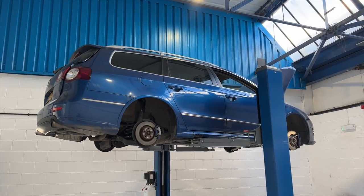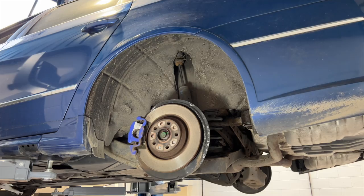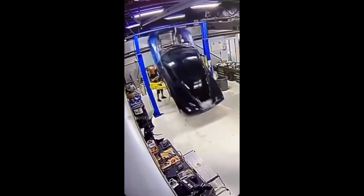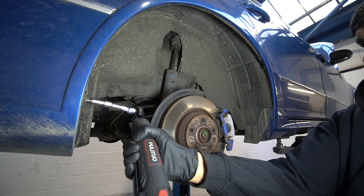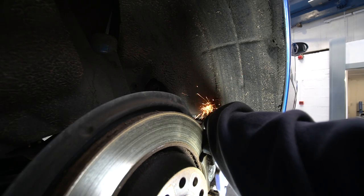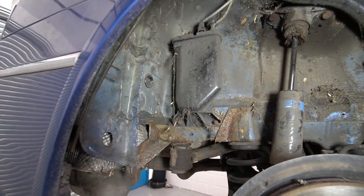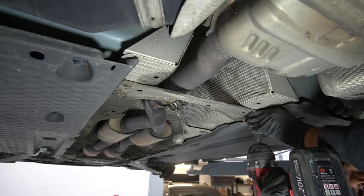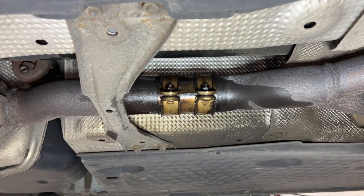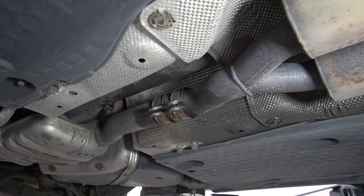The process of removing a rusty R36 rear end isn't actually that complicated — a lot of the stuff stays attached to the subframe itself and you mainly need to focus on what goes into the body of the car. It was my first time attempting a job like this and I didn't fancy a whole VW Passat tipping over when the last bolt came out. You start with the basics: remove the arch liners held with Torx screws — some resembled a T25, while others were compromised and required a nudge from the Dremel.